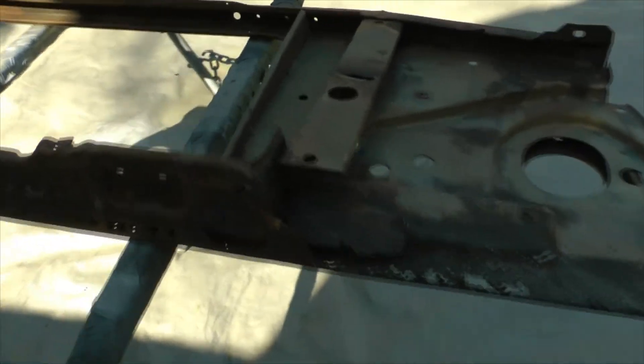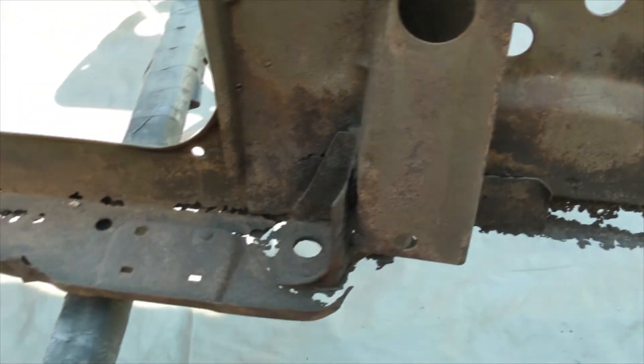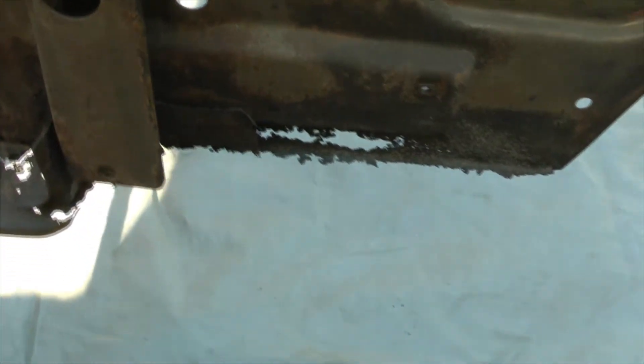This is the core support for dad's truck. I got it outside so the lights kind of screw up. There's a fair amount of rust repair to do — on the bottom and along across the middle. It's not horrible, but it's definitely got to be repaired. This one mount over here is mostly gone; it should be sitting right in here. This whole bottom side here is gone — there's supposed to be a bottom flange on this side, and that's all gone.